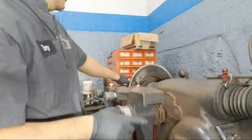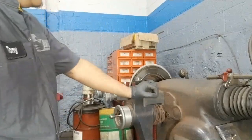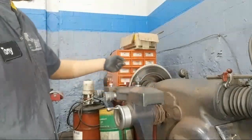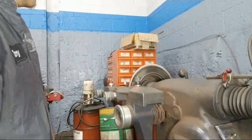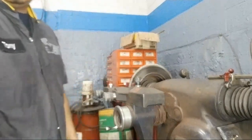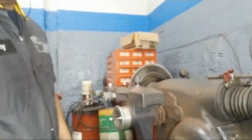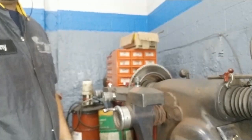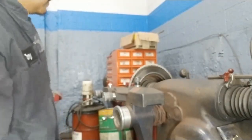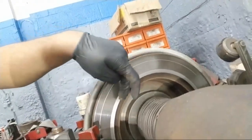There are two types of cut you can do, a slow cut and a fast cut. A slow cut can give you a nice cut through. You can see the consistency is going to be all the way around, unless you have a rotor that's severely warped. See, that's the old, and that's it being cut right now. So you want that same consistency throughout the entire cut.